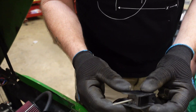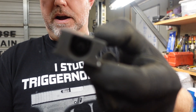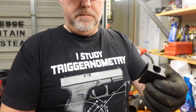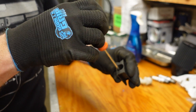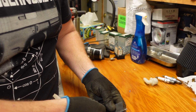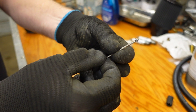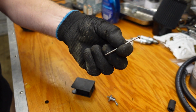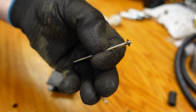Next I'm going to take this slide and the needle over to the bench, take it apart and adjust it. We're over here at the bench. In order to get the needle out of the slide there are a couple of Phillips head screws down in there — no big deal. Just take your Phillips head screwdriver and simply unscrew those screws, and now the whole thing can come out. So there's your main needle, and if you notice there's an E-clip — on this one in particular I think there's four or five slots for it to go.